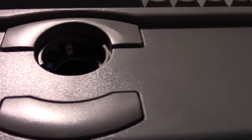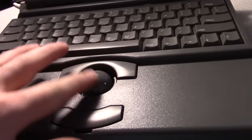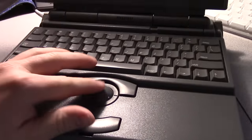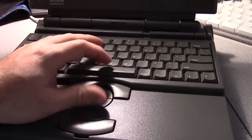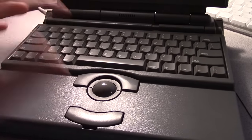But you'll see that these little red things look like beady little red eyes. Can you see that? There's one here, here, and there should be one on this side here. Those are the bearings that the ball rides on. And it rides really smoothly. Because of the properties of sapphire, or at least man-made sapphire, this ball rolls smoothly, and those bearings don't wear out. They really don't. They might develop a slight flat spot as they break in, but that's it. It's like riding on glass.